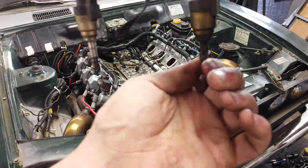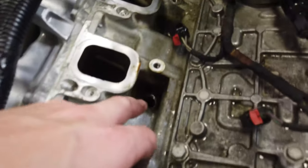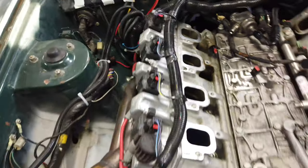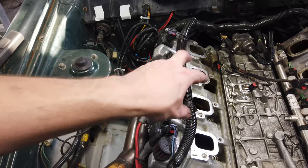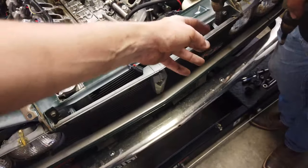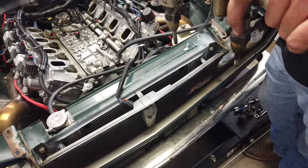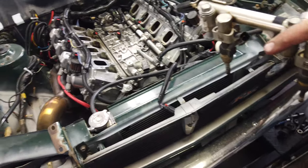Just by pulling by hand, we got the rail out - still a little bowed as expected. You can see: two seals there, zero seals there, two seals, two seals. When it loses these seals, it literally just shoots combustion up through here. You can see the combustion up in the head port here - that's the one I had to put my own teflon seals on without the tool. Either way we were able to pull it out, and the new kit is right here.